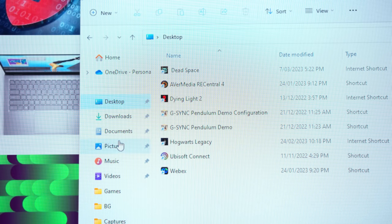This is compounded by the permanent burn-in risk associated with OLEDs. Using static desktop apps for long periods — like you normally would in a productivity setting — is probably going to burn in the display after a period of time. With that said, I wouldn't be concerned about burn-in if you are primarily using this display for content consumption, as the mixed nature of content like videos and games is unlikely to cause noticeable burn-in. But even with other OLEDs, the text rendering of this monitor does hurt that experience, so this is the least suitable OLED I've seen for desktop apps so far.